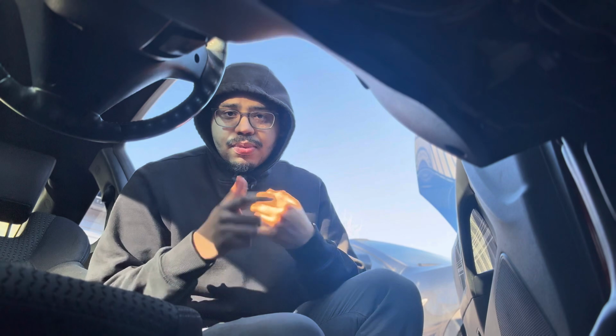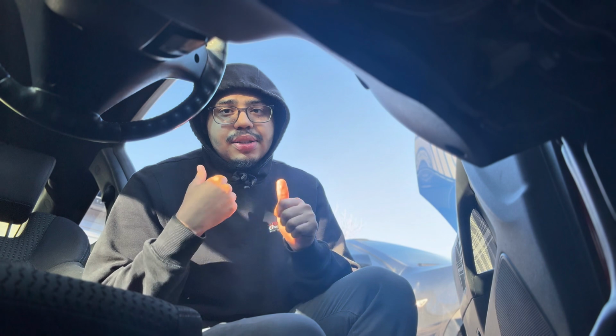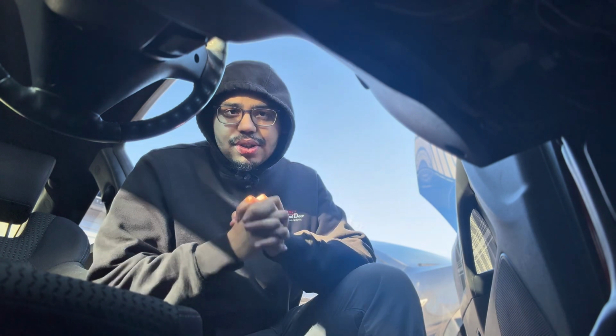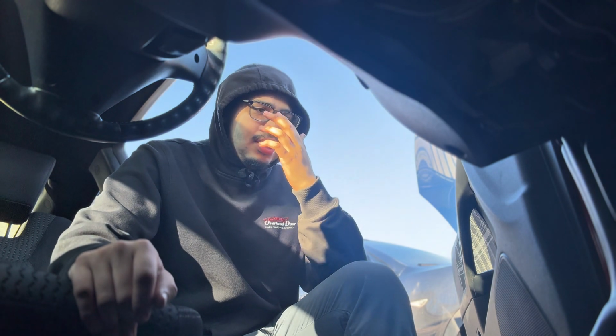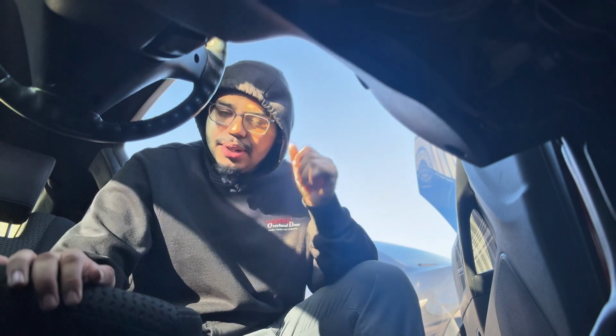Today, as you can see, it's gonna be a bunch of little fixing things in this video. In the previous clip I just showed you, that is my taillights staying on all the time. For some reason, my brake light switch will stay on. I guess when it's cold, it'll just stay on no matter what. If I put on the heat in the car and let it run for a little bit and allow the car to get warm on the inside, it gets rid of the issue where I hit the pedal and it stays on. But once it's warm, I'll hit it and then it'll turn off like normal.